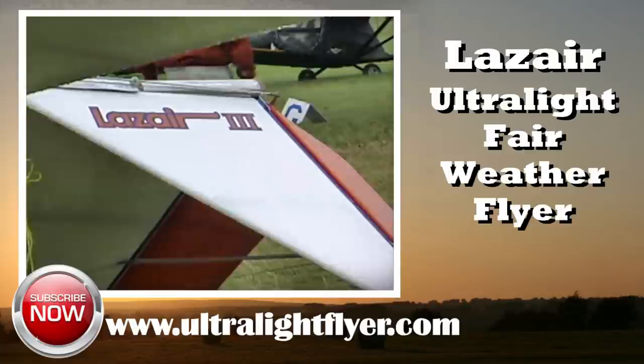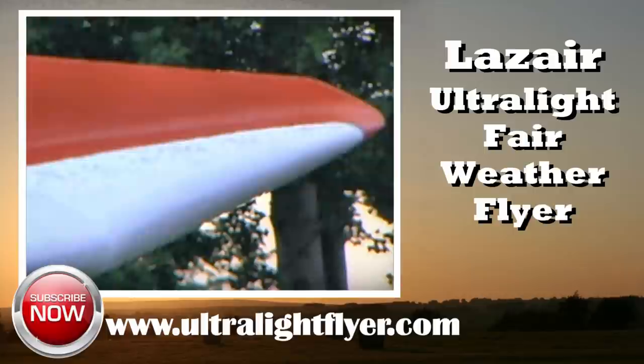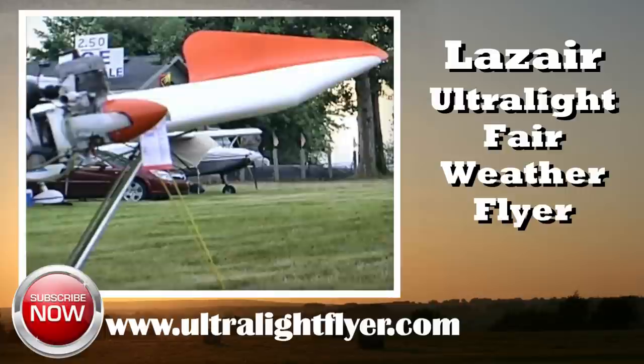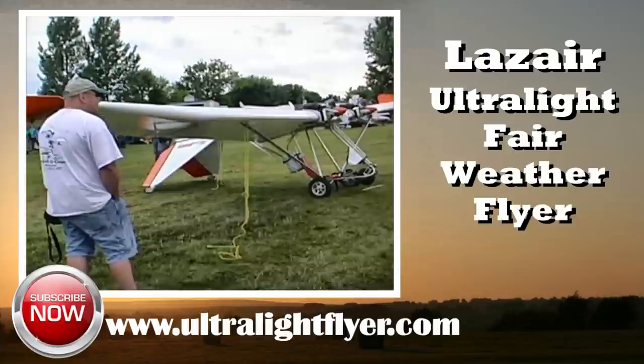If considering purchasing a used Lazair Ultralight, it is the ultralight flyer's recommendation that the plane's fabric, propellers, airframe, wings, landing gear, control systems, and engines be thoroughly inspected. If the history of the engines is unknown, it is recommended that the exhausts be removed and the pistons inspected for wear and seizure. At the time of production of this video, the ultralight flyer would estimate the resale value of a used Lazair ultralight to be between $3,500 to $6,500.